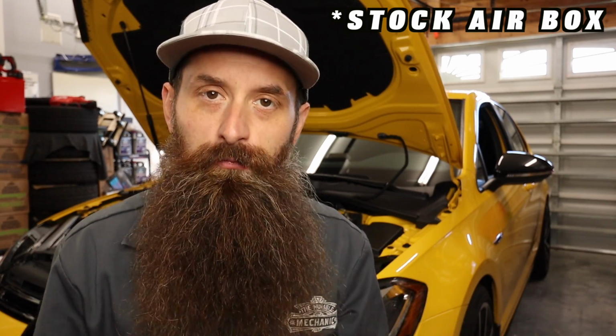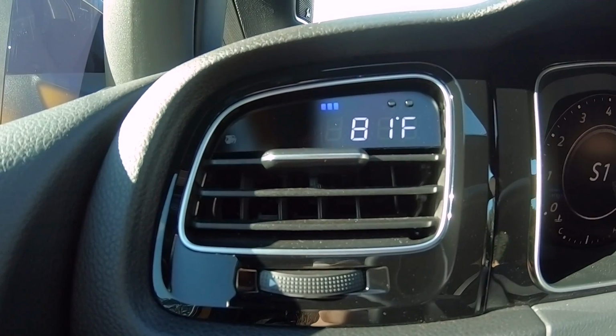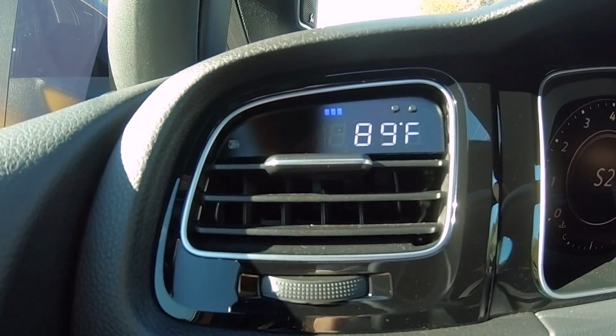I am actually surprised that our temperature readings climbed that high during this test. I thought it would be a couple of degrees, and maybe if you factored the percentage of ambient temperature difference, which was about 10 degrees, you might come to the conclusion that it really is only a few degrees. Where it's interesting is actually how much on heat soak that airbox does insulate the air filter and the air intake coming in.